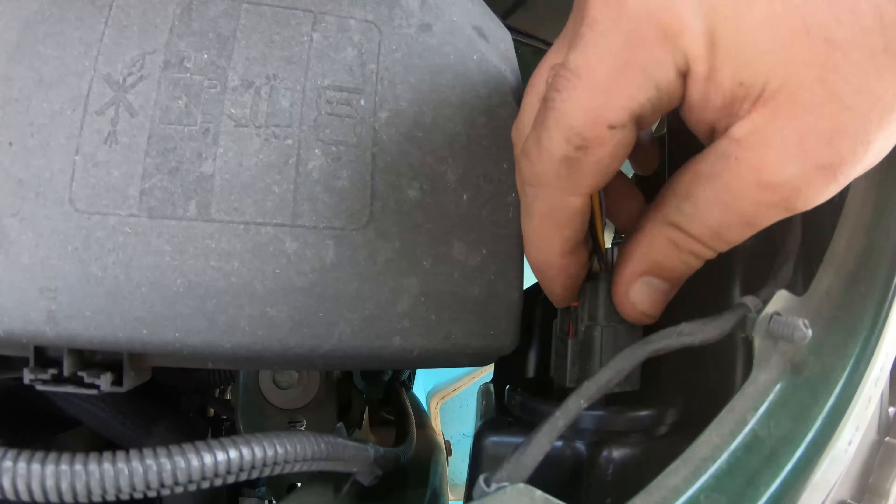For now I'll show you how to install them — super straightforward. You do have to pull the bumper. I'll have another video coming out soon on how you actually remove it, but if you've ever pulled a bumper cover before, once you've done one you've pretty much done them all. There will be some fastener coming up from here, probably a seven mil, and one coming down from this direction that clicks into the retaining bracket. It'll have screws across the front of the fascia, and there'll be a cover across the bottom — that's pretty much all that holds the bumper on.